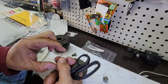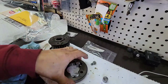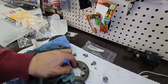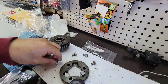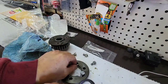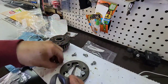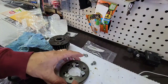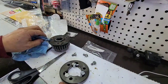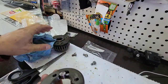Also, the springs, you may look at them, they are very similar, but how hard they push is important. So maybe these ones are worn out and don't have enough force to move them. Okay, so when this motor spins, all of them retract, and when you want to start it, they will block the inner shaft and make it work.